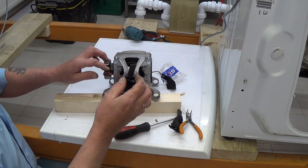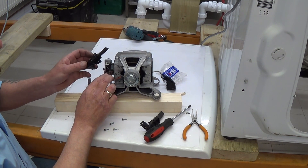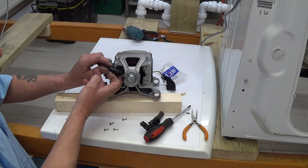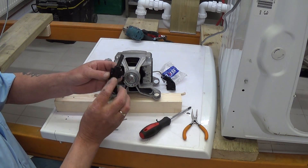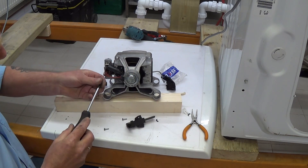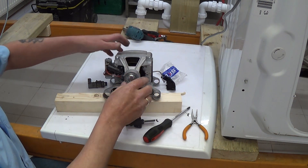The carbon brushes for this motor — which you will find on the link below and above — are part number 6758. I've put a link to these into the tutorial to make it easy for you. Just support the carbon brush, slide it down, make sure it goes onto its two location lugs which are here and here, then replace the screws.